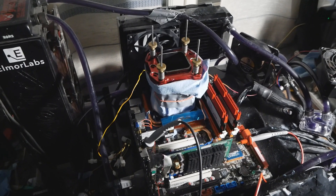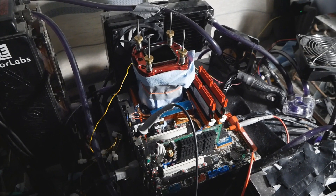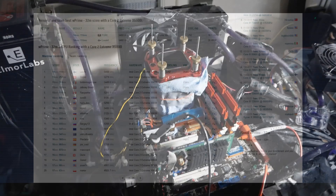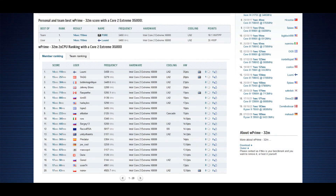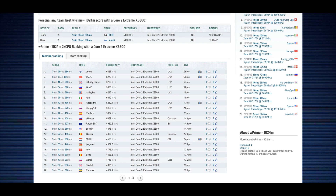As this was my first time experience with the X6800 CPU model, I think the overall outcome was pretty all right. I managed to get four out of six of the important top scores. Starting with W Prime 32M, my best run ended up being 14.11 seconds — a bit over one second improvement over the previous top score made by TAG from Austria. I got a few 14-point-something second runs and think I could have gone under 14 seconds, but I didn't have that much LN2 remaining. The 1024M was a nice over half-a-minute improvement over the previous top score made by TAG.